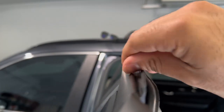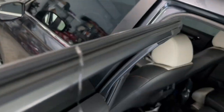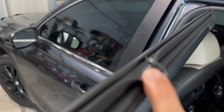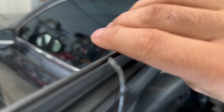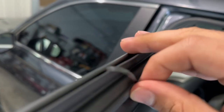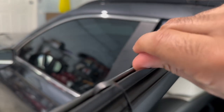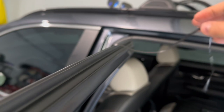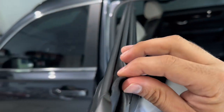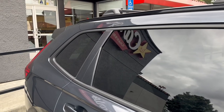The chrome has a little lip under here, so if you just run your thumb along it cuts the vinyl really easily — that's what we're doing here. You can see that excess strip, and there's that lip. Just running my thumb under here, it cuts along the crease and you just peel it out. Pushing in — you can hear that little pop — running all the way across, and this just peels out, leaving you with a perfect finish tucked underneath into the crevice.